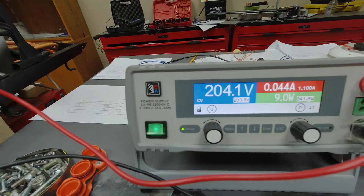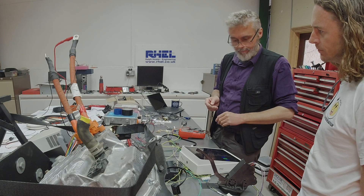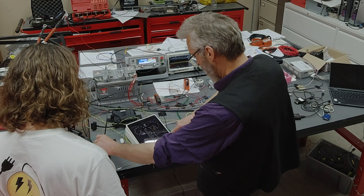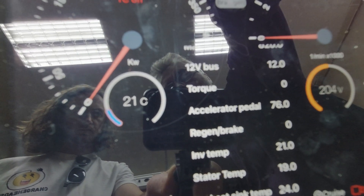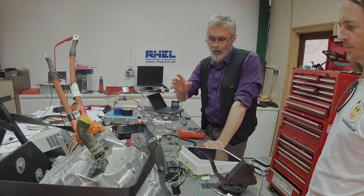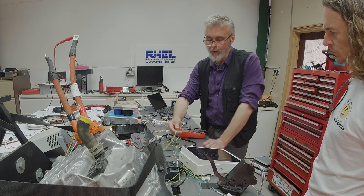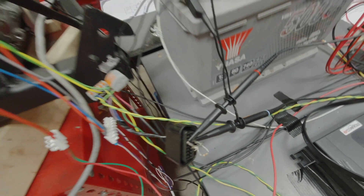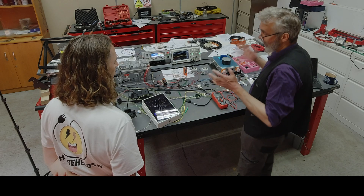It won't deliver more than a couple of amps so it's all very safe. We can see all the readings there - the voltage, the accelerator position - so all the inputs basically come up on that screen. The brains on the vehicle are in several ECUs, all interconnected with a CAN network. We've got a twisted pair wire, twisted to cut down electrical noise and prevent signal loss. We can see the CAN high and CAN low signals coming through.